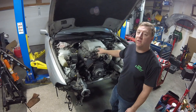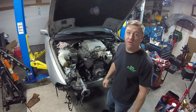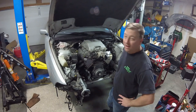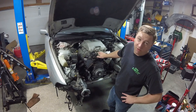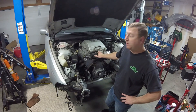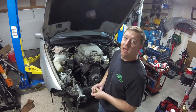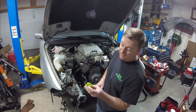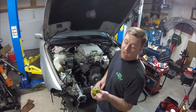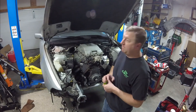Instead of just replacing the isolator piece, General Motors put a whole new supercharger on there. The core charge was $300, and I bought this one for $300 when I worked at the Cadillac dealership. I've been sitting on it for quite a few years with this project in mind. Most people change the isolator out for one of these - a 3D printed solid coupler from ZZP for about $30. That pretty much fixes the problem right there. I need to take it apart to put this in.